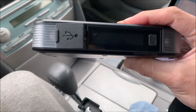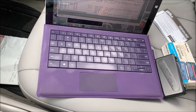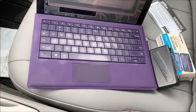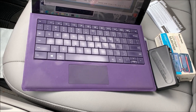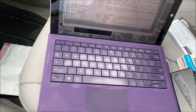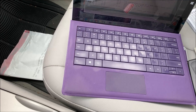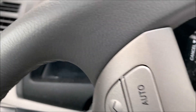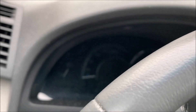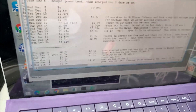This power bank still has 96% after two jump starts. I should mention that the Camry Hybrid's 12 volt battery doesn't actually start the gas motor — that's done by the big hybrid battery, and the hybrid battery is what charges the 12 volt battery. So it may not actually need a lot of energy to start the car. When I tried to start the car and it didn't start, there was a Check VSC system light that came on in the dashboard. Check VSC system relates to vehicle stability control, but it was actually just the battery being discharged — that was the problem.